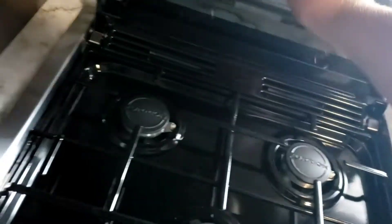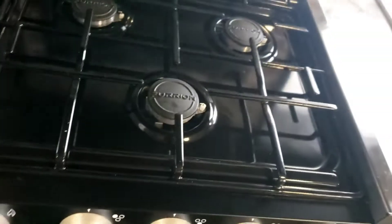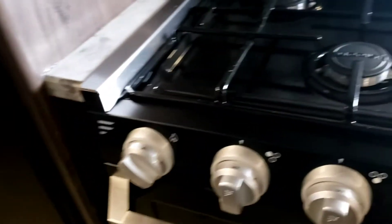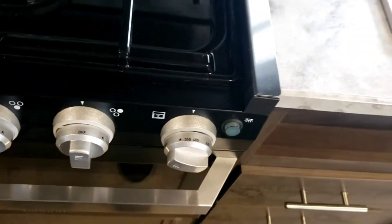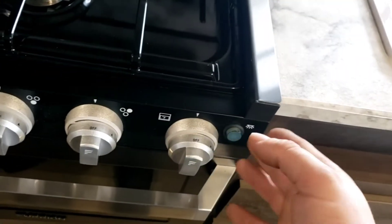Cooktop — super simple. To use it, turn it to the flame and twist the sparker — she lights right up. If you want to use your oven, it works a little differently. Turn it to the flame, push and hold while looking down for the pilot. Once that pilot is lit as you're pushing and holding, twist the knob, and then turn it to your desired temperature. When you're done, turning it to the flame shuts the burners off but leaves the pilot on — I recommend turning it all the way off before you go to bed. You do have a nice light for the knobs which also turns on the oven light.